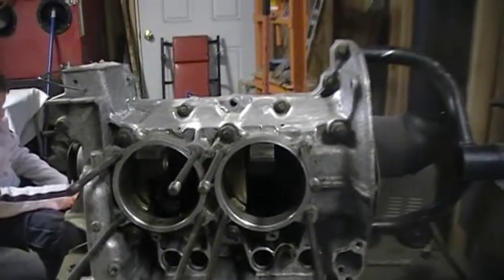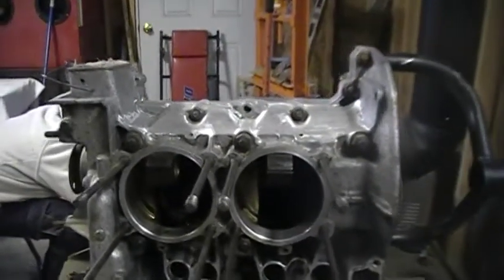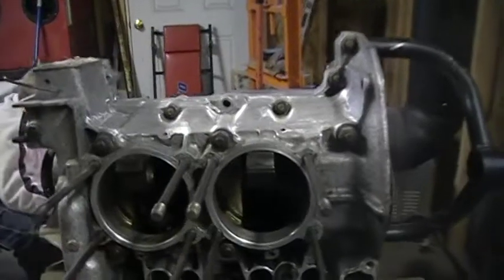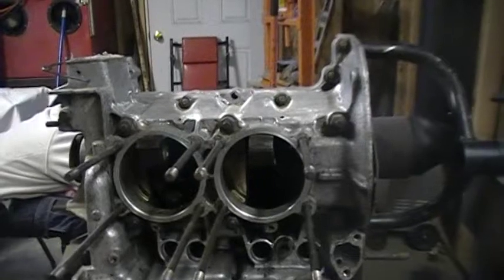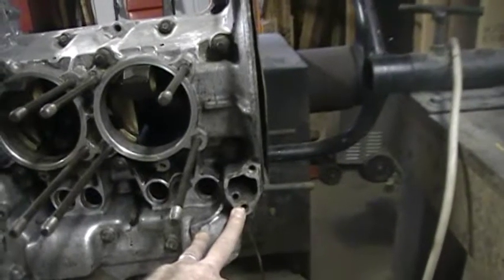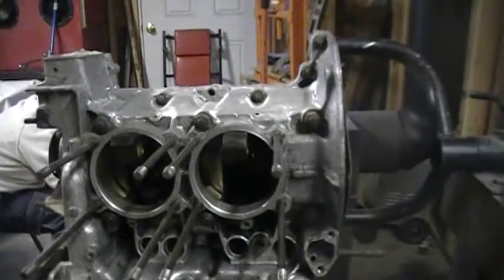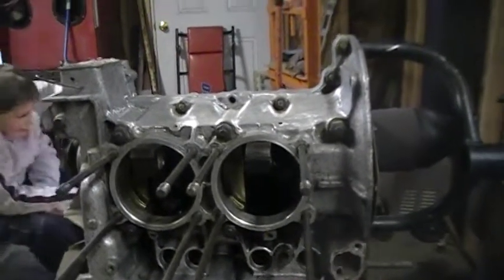There are a few other things I have to do before this engine is ready to go in. I do want to lube the cam up really good, and when I get it built, I'm going to crank it over — free crank it with no plugs in it — to get the oil pressure built up. I want to lube the cam lobes with some white grease, as that's one of the last things to get lubricant when a motor fires up on a Volkswagen. I also need to plug off this area here — this is where the fuel pump goes on a Type 4 engine. I'm going to be running a three-and-a-half pound rotary pump with a set of dual Weber carbs on this engine, so I'm going to make a fabricated piece to go over top of this.